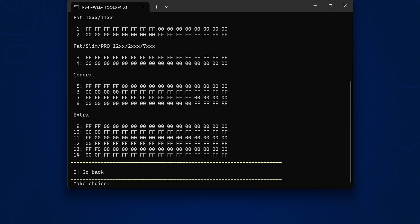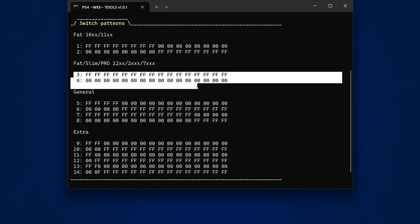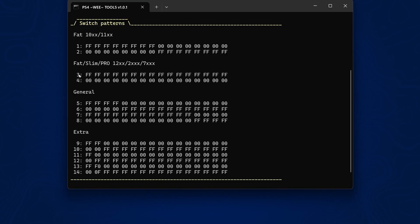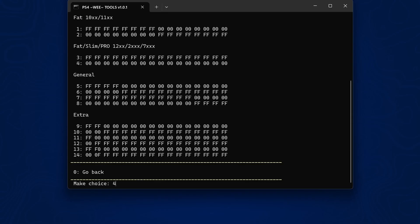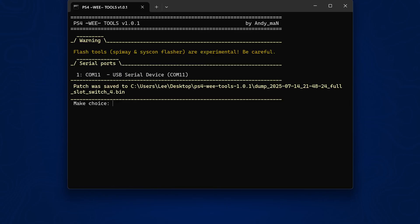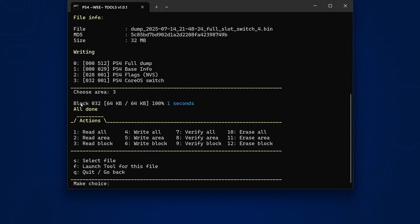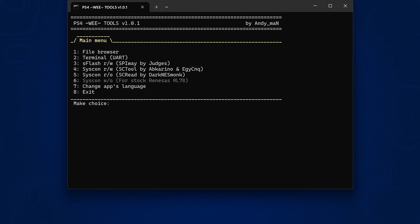Select option 4 and these are the different slot switch patterns. I'm on a 1216B console so for me it's going to be one of two options. The last time I reverted I used option 3, so this time I'll use option 4 to switch back. It says save as a separate file — Y for yes. Flash this to the IC — yes to flash it to the NOR Flash, then option 1 to select our USB serial device, then option 3 for PS4 Core OS Switch. Press enter and that writes that section to the NOR Flash — done. That's everything we need to do to the NOR to switch it over.